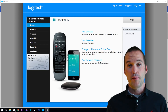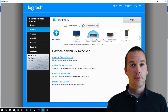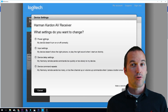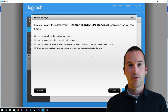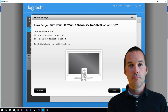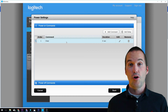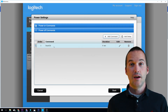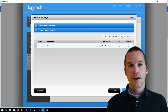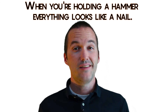I had one final hack for my purposes. I used a Logitech Harmony Hub to control my home theater, and I wanted the Echo to play through my stereo speakers when all the devices were powered off. To do this, I set a custom power-off routine for my receiver and told it to change the input to the CD input whenever the off command was issued. This means Alexa will always answer me through my stereo speakers unless the TV is on, in which case she'll use the built-in speaker on the Echo Dot. This was my personal solution to this problem, but I can't guarantee it's the best one.